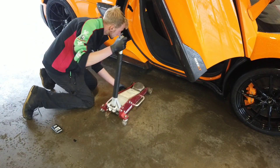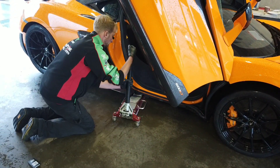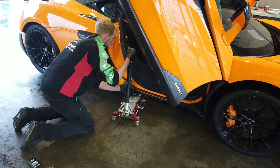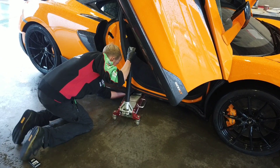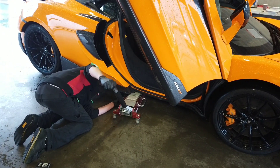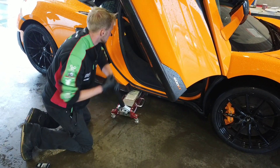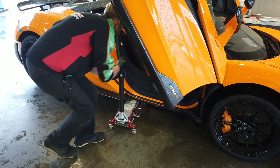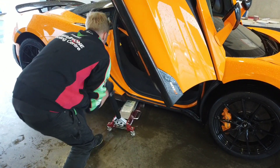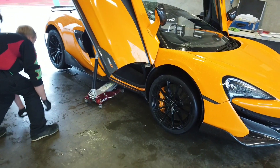After that, on to the chassis. You can pick up any McLaren from the centre of the chassis — where the chassis rails meet underneath the car there'll be a T-shape, with a little green-blue sticker. That means you can pick up the entire car on one side at the safest point. Use axle stands if you can. In this case all we're doing is checking the tyres and wheels, so a trolley jack is all you'll need. Pick up the car from the side — door open or shut, but open makes life easier.